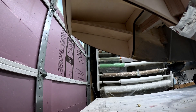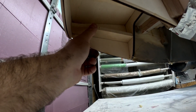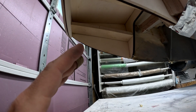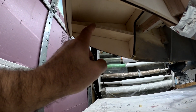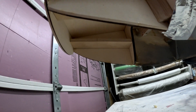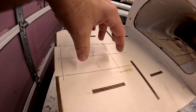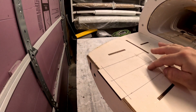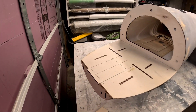Right now I'm working on getting this figured out to make sure it's going to sit right. As it sits right now, the gear may be usable without having to extend anything. The strut looks like it might be about an inch or so too long, in which case I can move it up about three-quarters of an inch to an inch. One issue is the retract has to come through this lower floor or forward plate. I went into CAD and drew up where that goes, so now I'm getting ready to cut this out and make sure the retract fits where it needs to go.